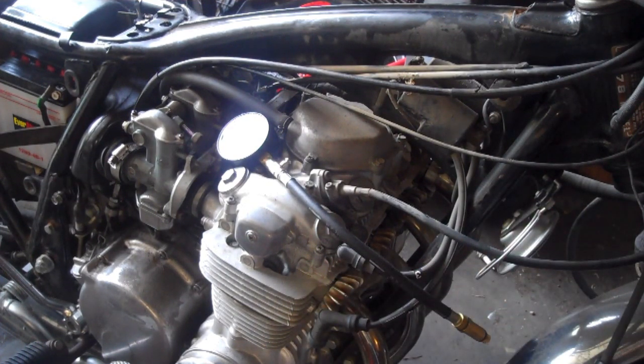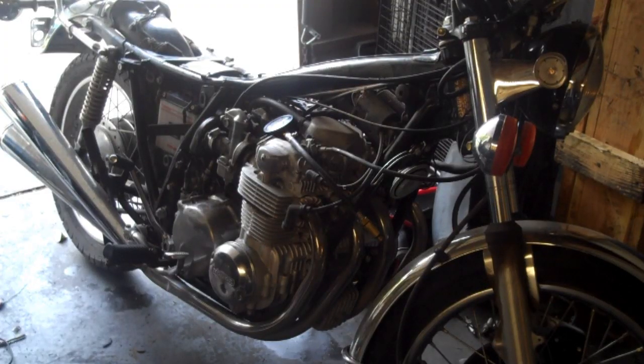A 10% variation between cylinders is an indication of a problem and it's time to repair your bike. So next time a motorcycle YouTuber asks about your compression, you should be able to give a real number — not 'feels like good compression' or 'sounds like good compression.' Even good mechanics can't tell by listening or kicking whether compression is off by 15-20 psi. If you're diagnosing why an engine runs poorly or not at all, just listening is not enough.